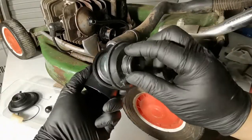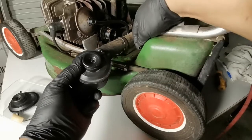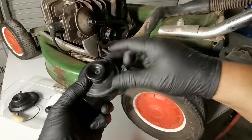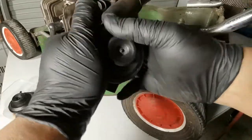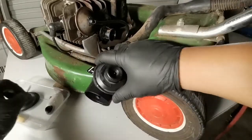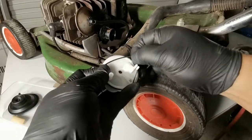Make sure it seats properly, and position the nozzle towards the side where the governor hose is connected. Make sure the rubber inside is not folded. Press it to lock the cover. Then install the primer cap — place the O-ring around the primer cap, the metal needle with viton tip, and the float.